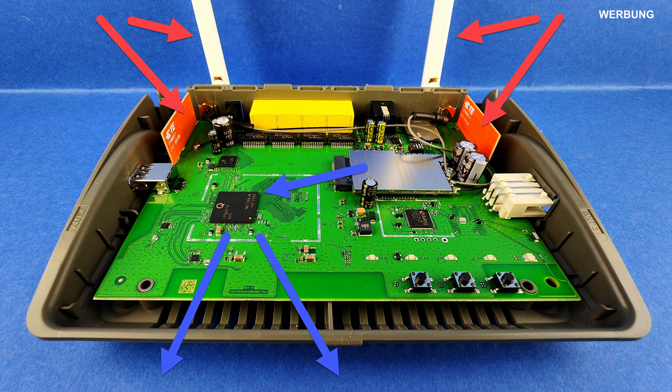This is shown by the blue arrows. This 5G to Wi-Fi router also has two tiny Wi-Fi antennas on the back of the motherboard, printed directly on the board, sitting roughly in the center underneath the two long blue arrows. Last but not least, you can also get the internet out of the Fritzbox via the four yellow Gigabit LAN ports. With this knowledge about the antennas, the question now arises: where is the optimal location for such a 5G to Wi-Fi router?